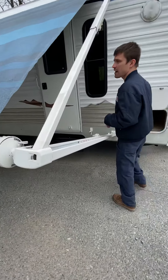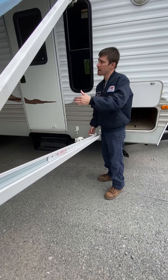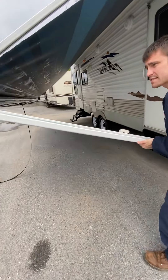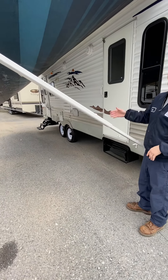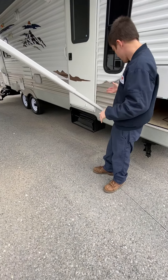That tension helps you avoid any light rains and things like that. I always recommend rolling the awning in during heavy rains. If you don't have that option and it's a light rain, water will run off pretty well. Heavy winds — always recommend putting the awning in. You will extend both sides the same way with this lever right here, and that's it.